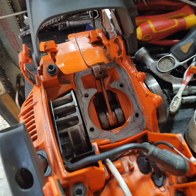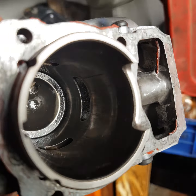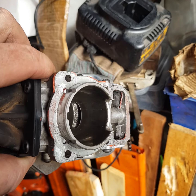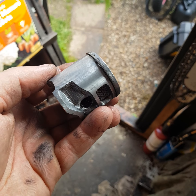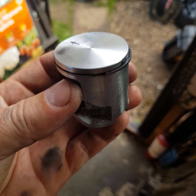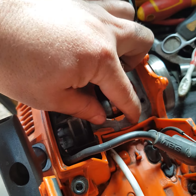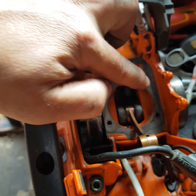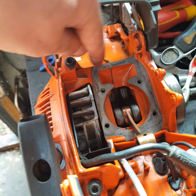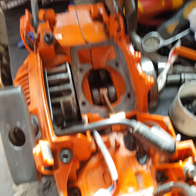Okay, remove the existing cylinder, which has signs of wear. This was the aftermarket piston installed. These are not damaged, still usable. Okay, but clean the base where the gasket goes. I'll use some mastic anyway, because the cylinder has these four fixing points, but nothing to reach the front here. So once I have the new one on, we'll see how it goes.